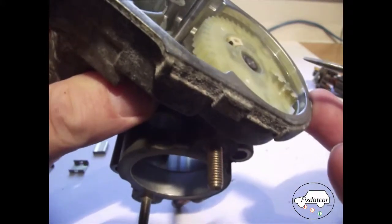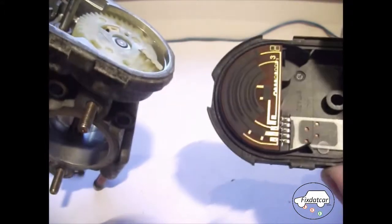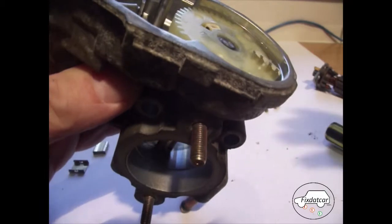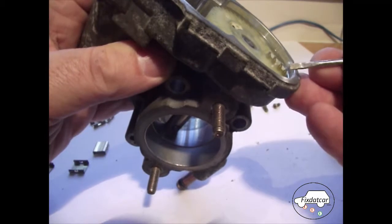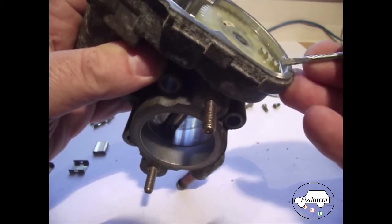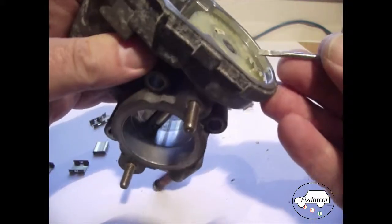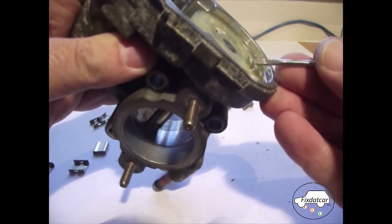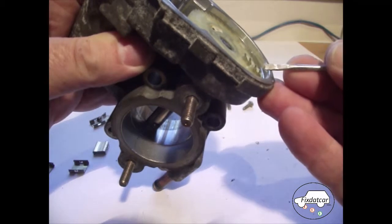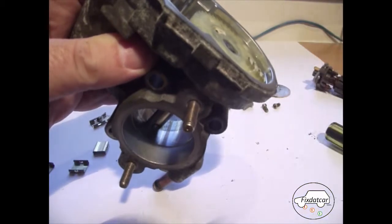So if you look very carefully at these wipers, you can see there are 4 wipers that run on these 4 tracks here. I think there's like 2 tracks per potentiometer. So I'm guessing this is looped through here. There's one. If you look very carefully, you can see on the camera, that wiper is slightly lower than the others, and it's loose. So that's not pressing properly. Got nice spring action there, nice spring action there, nice spring action there, and a poor spring action there.